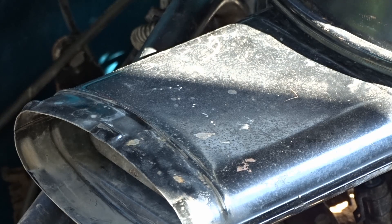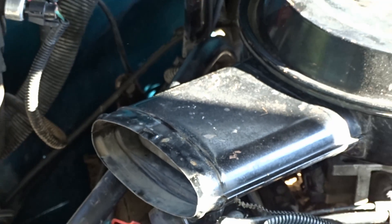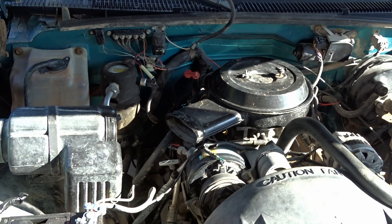There will be a link in the description for these parts so you can find them at a really cheap discounted price on eBay. Eventually we'll replace enough stuff on this truck that it's going to run right — one part at a time. I did test this sensor and it was showing full vacuum at idle, which should not be, so we definitely have an issue with the MAP sensor. I checked the wiring — wiring is fine, ground is good, signal wire is good, voltage wire is good — so that leaves either a problem internal to the computer or the MAP sensor. These sensors go bad anyway, might as well replace it; this MAP sensor was eight dollars on eBay. There will be a link in the description — as always, like, comment, subscribe, and be safe out there.